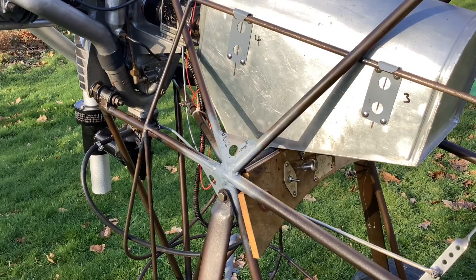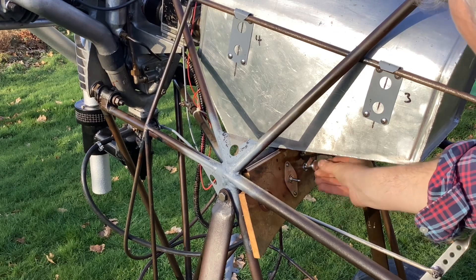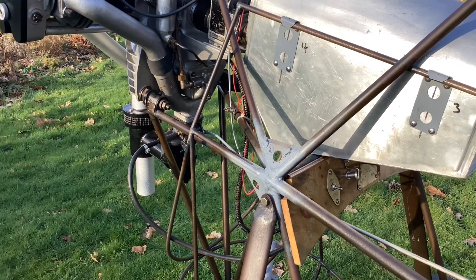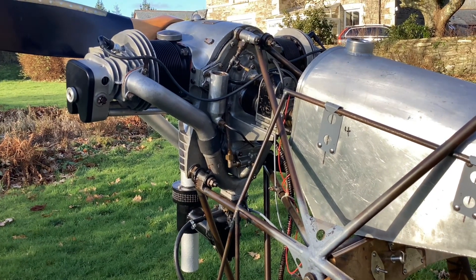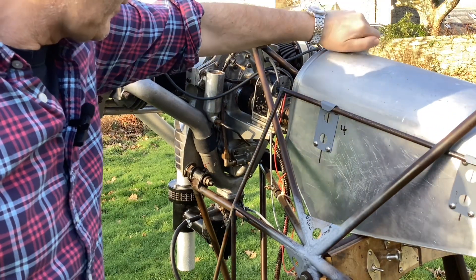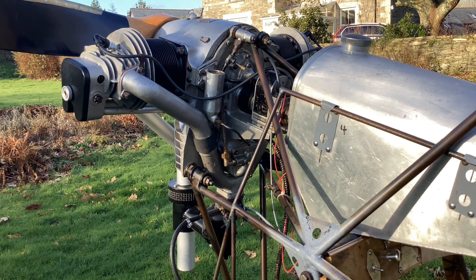You might recall that when I last ran this, the advance and retard kept coming out. I've put a natty little keeper on it so we can retard it for starting, then it goes in and the keeper slides on top. I've also had the cylinders off — we had a few oil leaks, one from the oil filler and another from around the base of the cylinders. I took the cylinders off, spent about an hour cleaning around them, and put a whole load of sealant around them. They don't have base gaskets, so they're just sealed with sealant. I'm hoping this test run will demonstrate that most of the leaks are gone. Anyway, we'll start it up and see what happens.